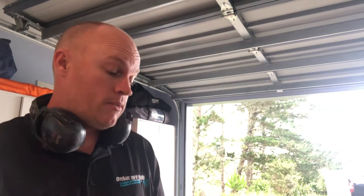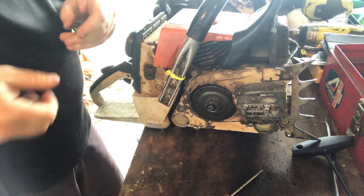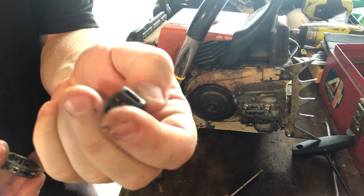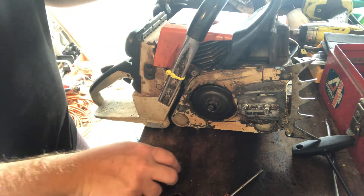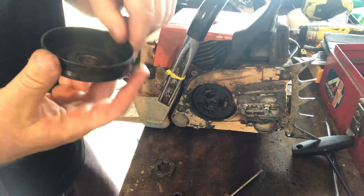I'll take the bar off and give you a look at what's going on. Oh wow, that's interesting already! Straight away when I took this off, this is what fell out - that's the needle cage bearing. It's missing its rollers, and the sprocket has come off because there's no keeper or anything like that. Inside of that clutch needs a clean out - a lot of what I do is cleaning as well.